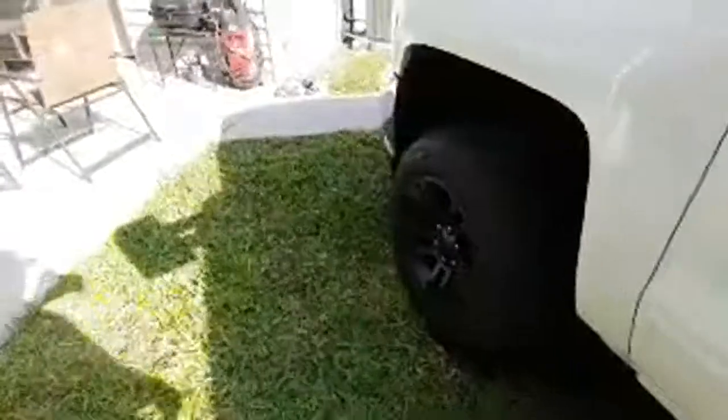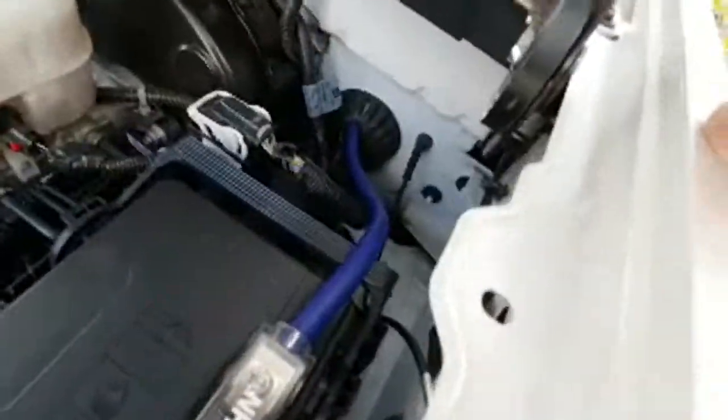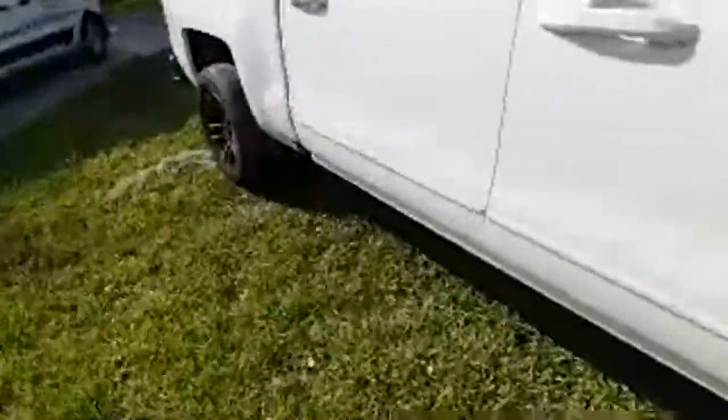Was busting ass last night getting this thing done. Haven't even put my floor mats back in yet. So, this is what we got so far. We have fuse holder with fuse in, 1/0 ran back. I'm getting ready here in a little bit to go pick up my batteries. We're gonna try to squeeze 2 Group 31 AGMs up under here, one there and one here. And if that all goes smooth, I should have plenty of power for a little while.